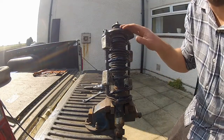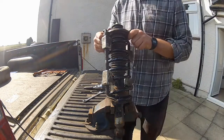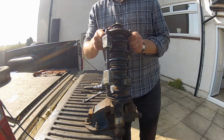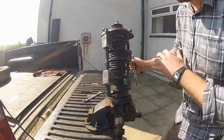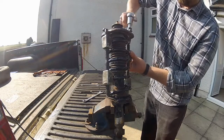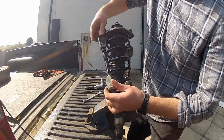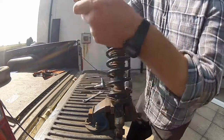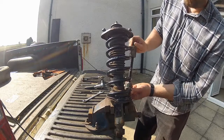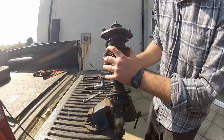When the spring is applying some pressure to this top mount, now would be a good time to double check it's in the same position as when you took it off. Mine just wants a little twist anti-clockwise - about there, perfect. Now you can continue to slacken these clamps gradually until they fall off. That's the spring securely back in the strut.